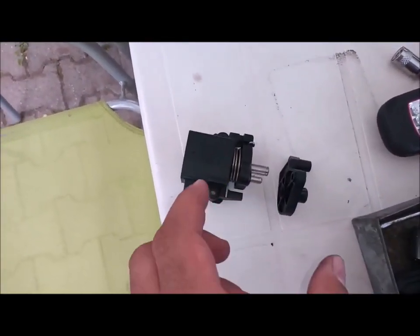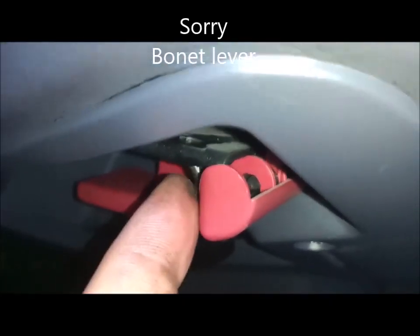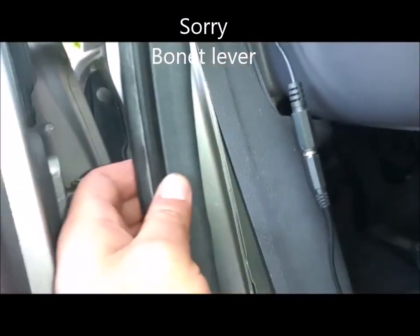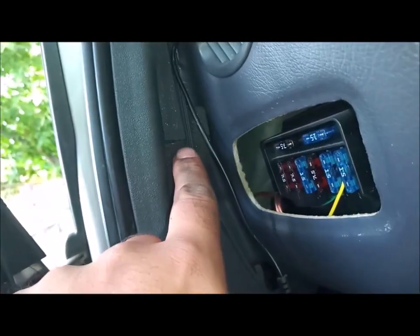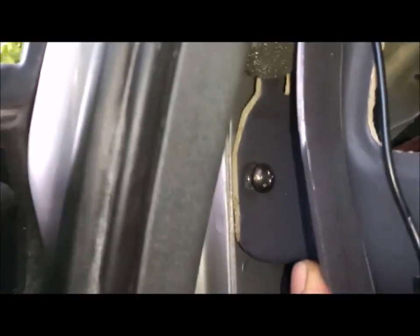When you take it out, be careful, and when you put it in also be careful. Now, in the detail video: you have two screws here, one here, and one here. Then you'll remove the screw holding the handbrake — just loosen it and leave it there. Then take out the panel. There is a clip here — just pry it out like this. Don't ruin it, don't break the panels. Most videos show you how people break it. I have one here that was already broken by the guy who installed the reverse sensors.